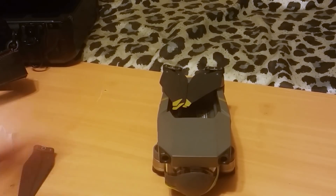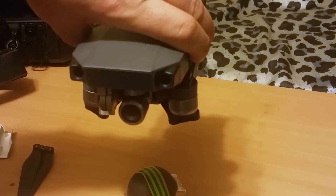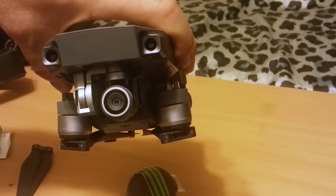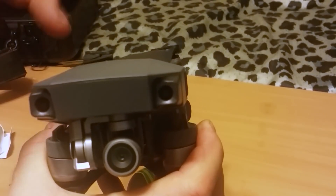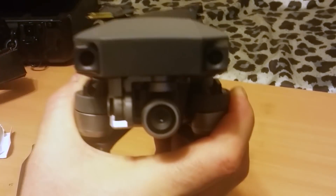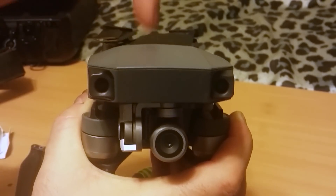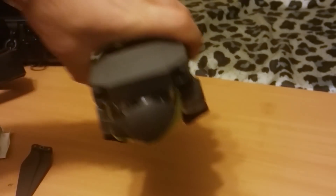Now, what was my problem? I can show you the footage — I took off and my gimbal was fluttering, which led me to believe it was the gimbal at fault. I recalibrated the gimbal and also recalibrated the IMU of the copter, but it made no difference. It was sort of vibrating up and down. I even tried carefully putting my finger on top and touching underneath to feel for vibration, but there was no vibration I could clearly detect — it was kind of fooling me.